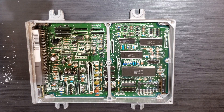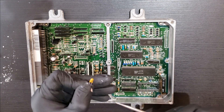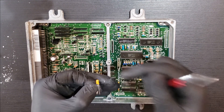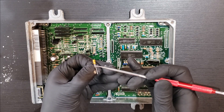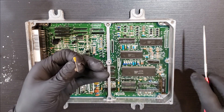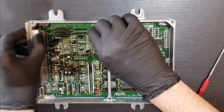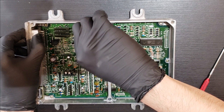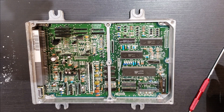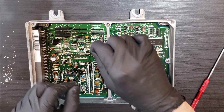Now we're up to C60, the one microfarad capacitor. This is polarity sensitive — the longer lead, which should be marked, goes on the positive side. It's hard to see but the longer side goes in like this. With it in the same area, we'll also install the J10 jumper, which is just a piece of wire. Put that in as well and then solder both in place.